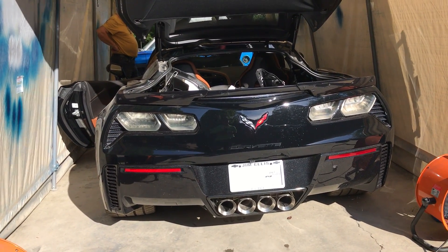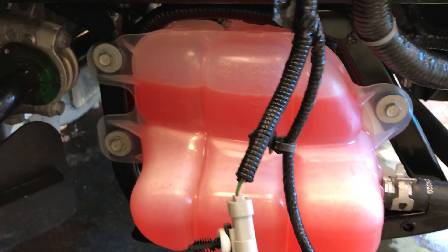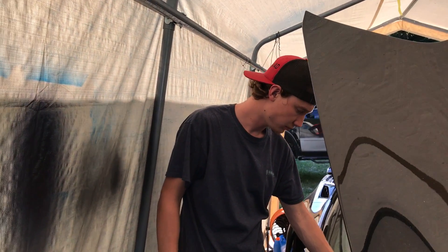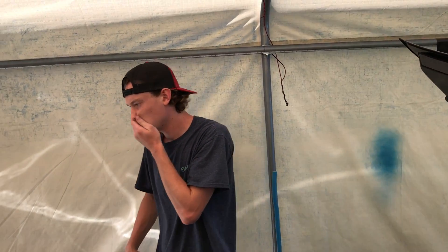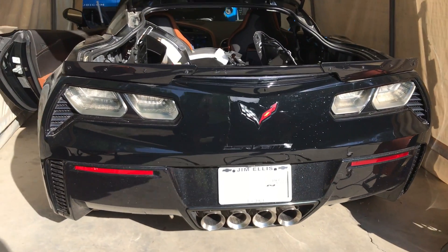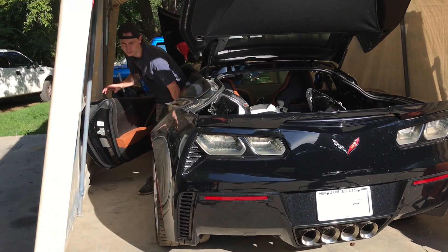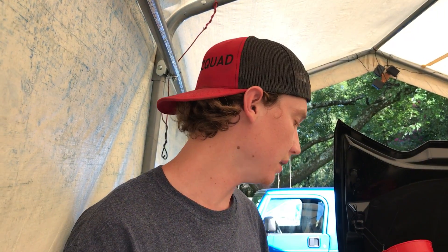That thing sounded so good. We may go get a little pump from the local parts store - we're gonna have to build some sort of system to vacuum all that air out. We're definitely going to pump all that air out, put a little suction on it. We just picked up this automotive test and bleed kit - a nice kit. We're going to make something to put a vacuum on that little system to vacuum out the air, like how they do it on these Z06s on YouTube. Same vacuum they use for brakes - sit there and pump it.